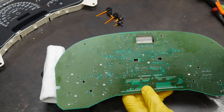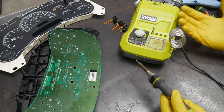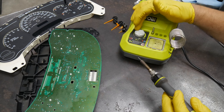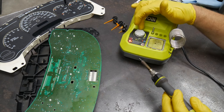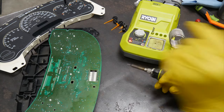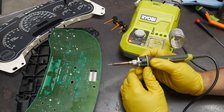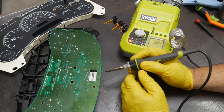I like the Ryobi for this because some portable soldering irons don't have temperature control — gas-powered ones give you no idea of temperature, and even some cordless tools lack temperature selection. On this one I can vary between 400 and 900 degrees. I'm going about halfway, so around 450–500 degrees. Since I'm just pulling solder off, I'm not going to prime or re-tin the tip — I'm just going to try to draw some of this solder up and remove it from between those two pins.